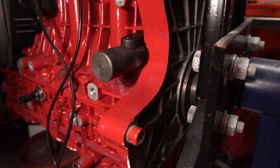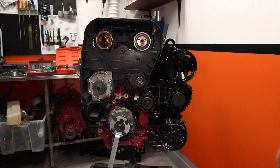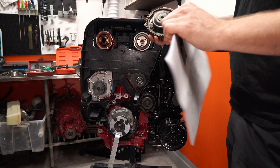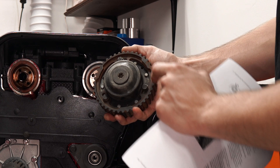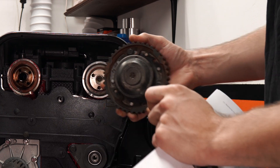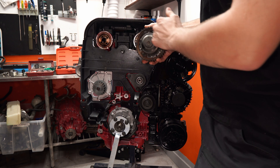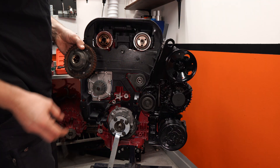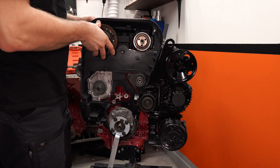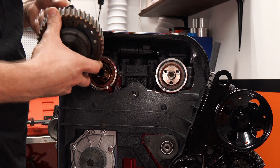With the crank lock and cam locks in place, we can go ahead and reinstall the VVT. It says to slacken off but do not remove the screws which secure the timing gear pulley to the variable valve timing unit. I interpret that as we need to undo these three screws so we can move this gear around on top of the VVT. Now I have loosened these three bolts so we can move this freely. We take the VVT unit with the gears on it and push it back on.